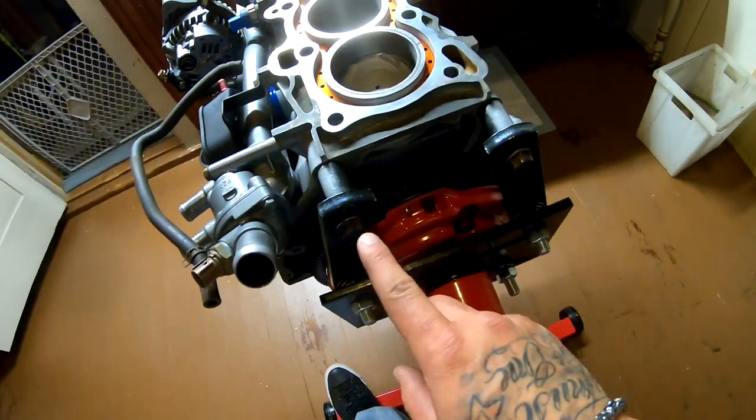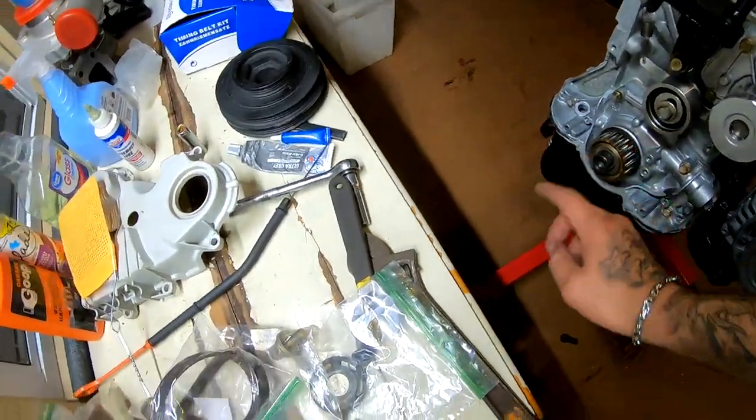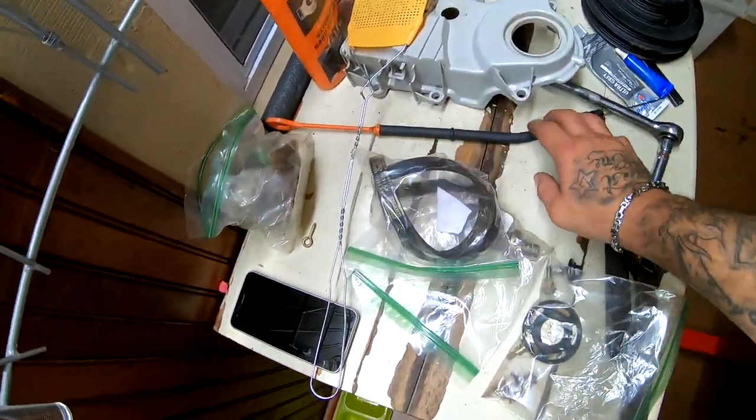So right now, I'm gonna go ahead and call it a night. It's pretty late. And in the morning, I will take these two off, put my engine on the floor, spin my crankshaft to top dead center, put the other piece in there, put my cover, this guy, the alternator belt, a whole bunch of little pieces that go in there, and we will be ready to put the transmission on. We might even do the transmission if we have enough time, but I think this is gonna be the end for now. So I'll see you guys in the morning, which will be in 2 seconds.